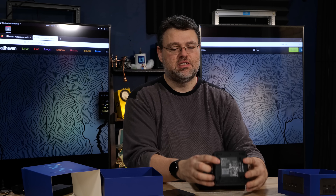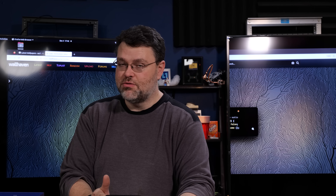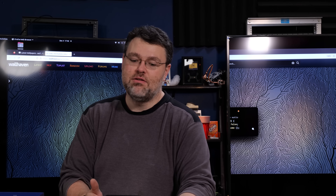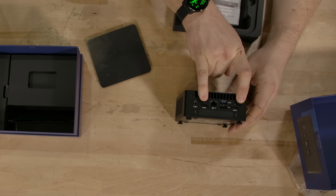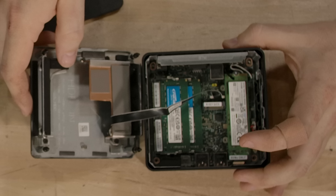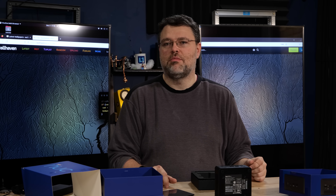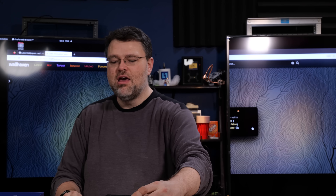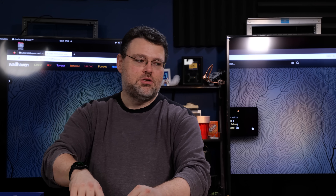You might think this is 65 watts, but that power brick is actually 120 watts. If you're running at full turbo with those 4P cores, plus using the front USB charger for 35 watts of power delivery to your cell phone, and maybe the optional Qi charger adapter, 65 watts ain't going to cut it. We also have two HDMI ports and an optional connector pre-installed with a bracket that will hold an RS-232 breakout for serial port use — really for OEM use cases like point-of-sale terminals. There may also be options for VGA or an M.2 accessory.